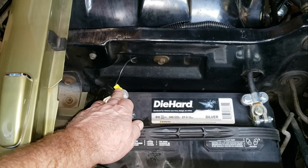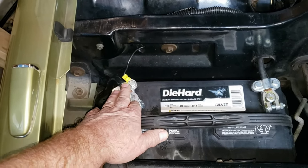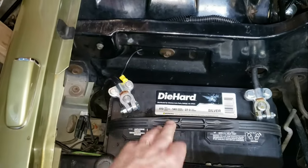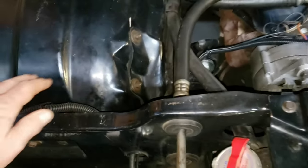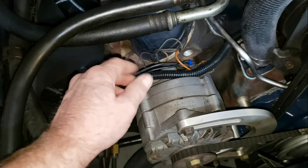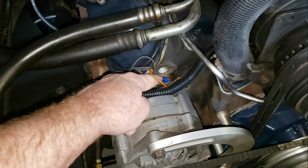The ground is connected here — I'm not really crazy about the yellow, so I just went straight here because it was really easy. I may move it later. We've got corrugated wiring loom snaking down through here, following the line of the original hot wire from the battery to the alternator, and we've got the power for the relay to the alternator.